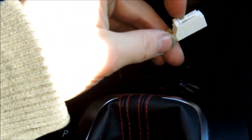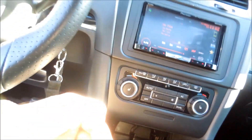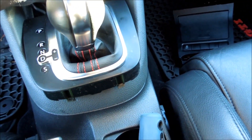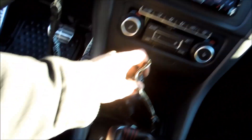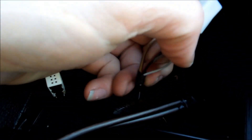So I'm going to tape these up really good and then go feed them into the car. First thing I did is I pushed on the traction control button, sunk it in with my nail, got in with my other nail and pushed in, and then I was able to pop it out and took the tray completely out. Next thing I did is I put one hand in here and one hand around the back, grabbed the GPS wires and brought them through. So now if I lift this up you can see that these are down here. I chose to hide them here because there's a big deep pocket in there with nothing in it — I already checked and I get clearance. I tested this out with my meter: black and red is positive, brown is negative.